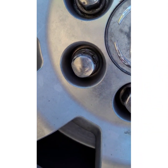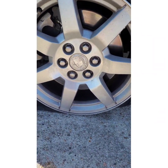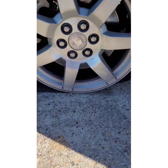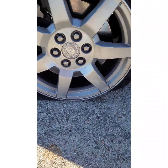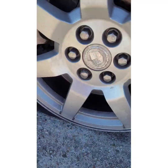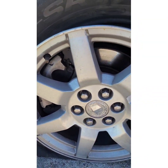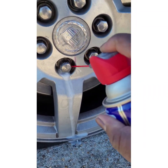So I got a stripped lug nut I'm about to try to get off of here. I'm going to spray some WD-40 in there and I got two 12-point sockets I'm going to try to put on there. See if I can get it off. The thing I'm going to do is spray some WD-40 in there, hopefully loosen it up. We're going to pray.